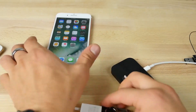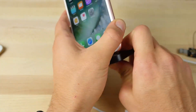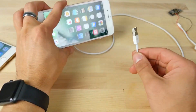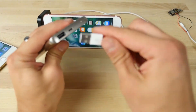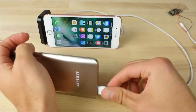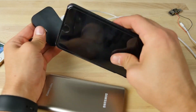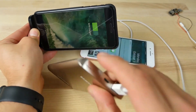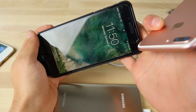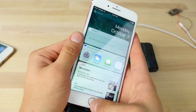Okay, a couple minutes has passed. I'm gonna go ahead and unplug this and see if a regular charge still works. Nope, I'm unable to get any charge. So, iPhone 7 Plus right here — no tomfoolery. I'm gonna go ahead and plug it into this USB bank — it is a Samsung, don't hate. But I'm getting no charging. If I plug in my personal iPhone 7 Plus, it does charge. It is on and working, it is charging. But if I plug this one in, it appears the lightning port is done for.